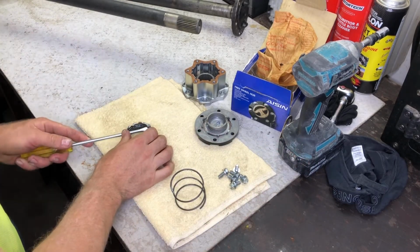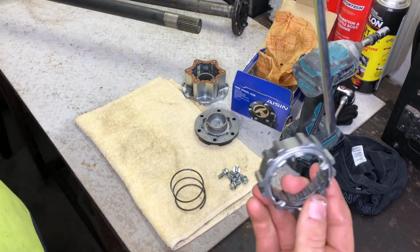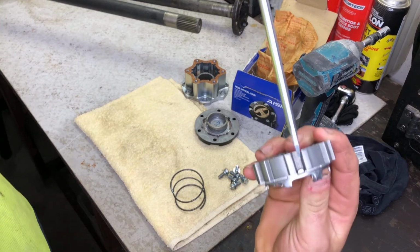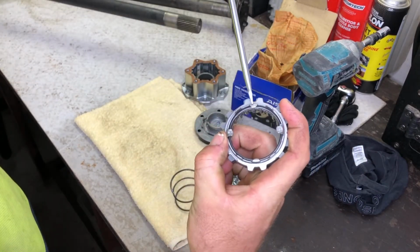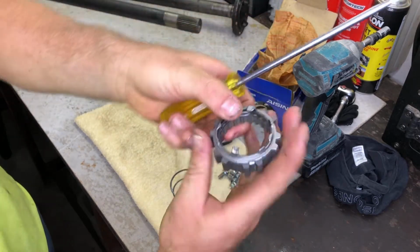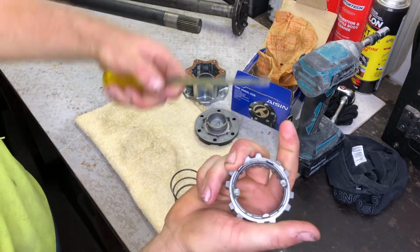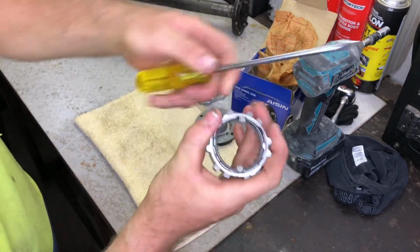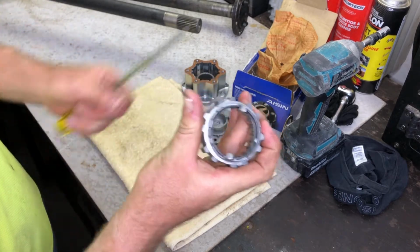You can see the pawl is in position when it lines up with the profile of the clutch splines. Then with the bent end of the spring against the larger inner tab, you need to tension it by positioning the spring over the two smaller inside tabs of the pawl. Starting near the end of the spring, I lift over the first tab from above, then over the second tab from below using this flat blade screwdriver. With the spring located inside the pawl, the clutch assembly is now secured together.